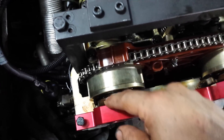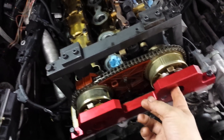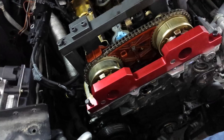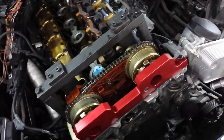The very important thing is to set up the front timing fixture. Behind it there are some notches that need to line up with the cam phasers. Once everything is lined up, go ahead and torque the front bolts. I'm using the old tensioner just to keep tension on the chain while following the instructions — I'll replace the tensioner in a minute.